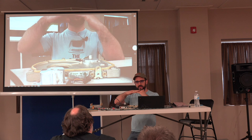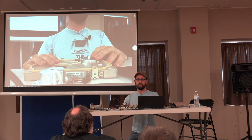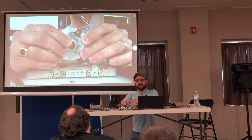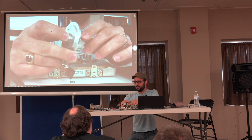Well, if you had the platter height wrong, those heads are going to be on a slight angle, which then, instead of gliding over the disk, are going to be digging into it with a corner of the ceramic head, so that just wouldn't work. So I did try and soak this with some penetrating oil, but I think one of the problems is there's a bearing near the top and you just can't get at it. So I don't have good news for these small Seagate motors.